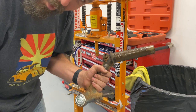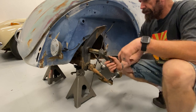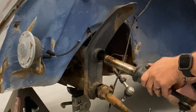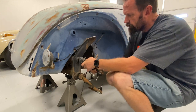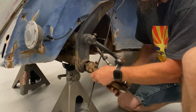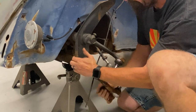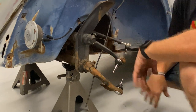These old cap ball joints install quite nicely. Now that we've got new ball joints pressed in, our original seals at the beam are actually still in really good shape. The grease and the arms and everything else are obviously clean and in really good shape. So we're just going to jiggle those guys back in place. Tighten the set screws, then we can put our new spindle in place.